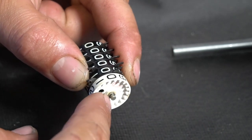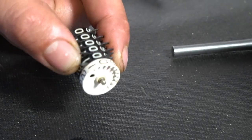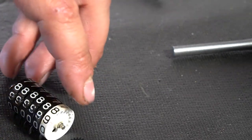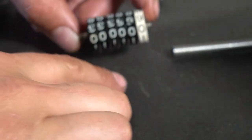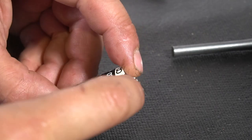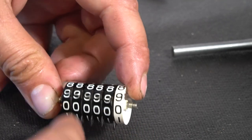We can go ahead and put our C-clip back on and then our external gear that meshes with the gear that's still on the main bracket of the chassis. When you're putting your other C-clip in, push the shaft out with your thumb so you can get to the notch that's in the shaft end over here. Hold it firmly with your thumb.